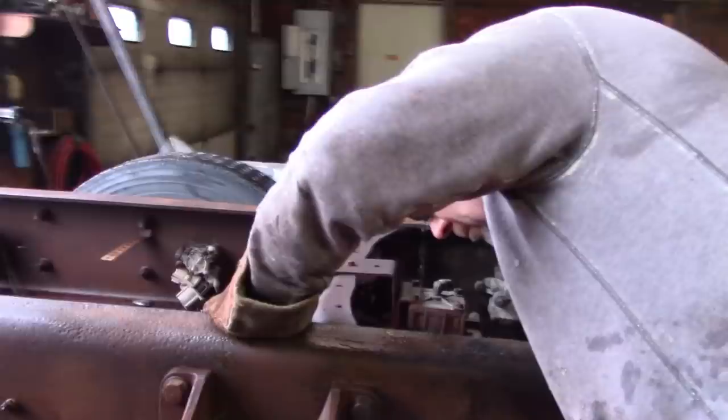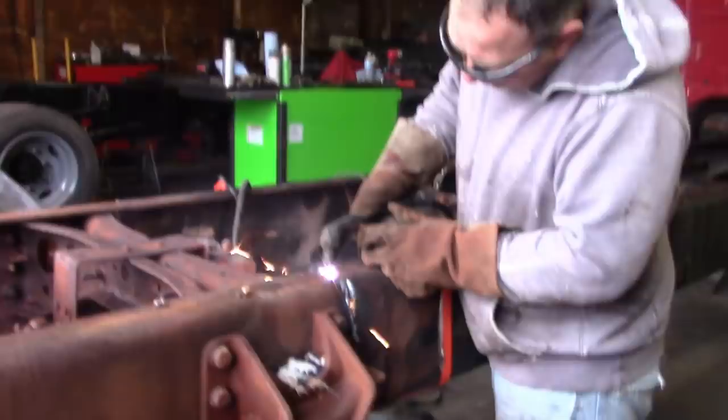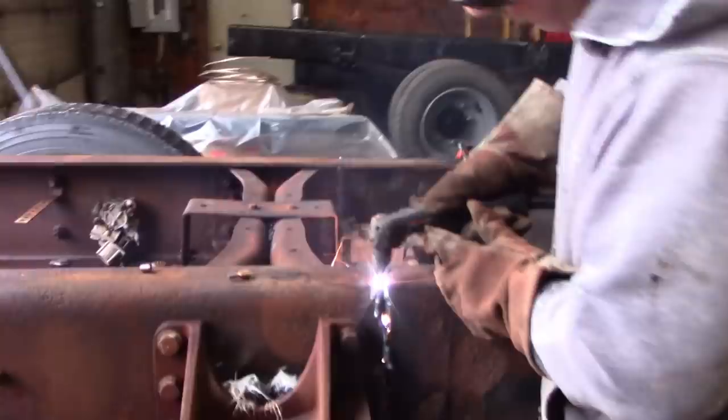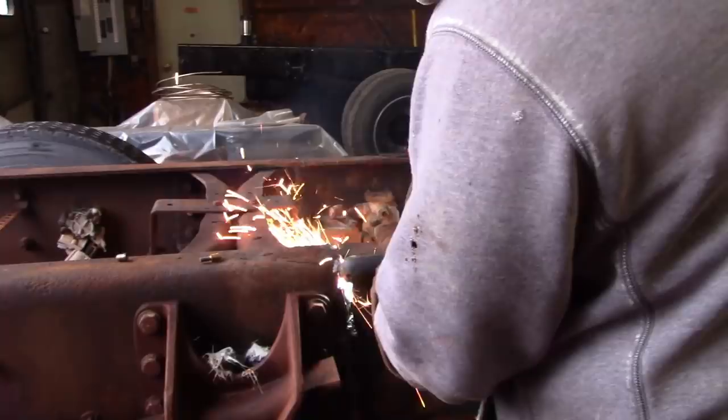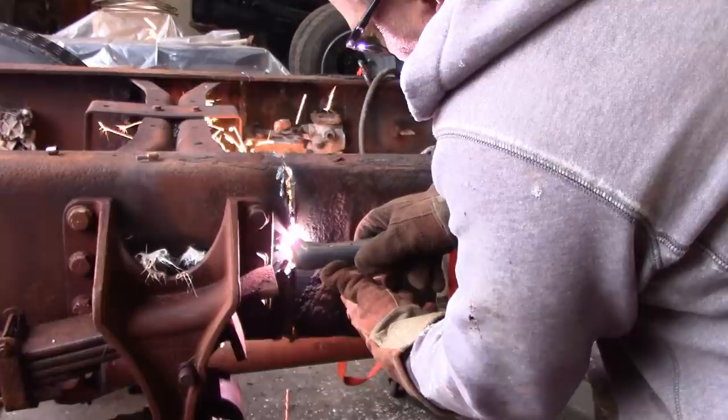I've got the chain set up supporting the back of the frame of the truck. What we're going to do is cut the frame and then let the rear section tip down. I'm cutting the bottoms so I can be in a good place when I cut it, so they can just pop up and be out of our way and we won't get hurt. You can see in that leaf spring hanger there's some remnants of the floor — all of this is no good. We're just going to cut it off.